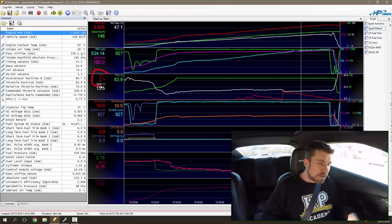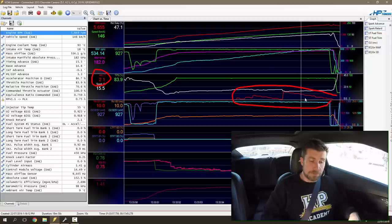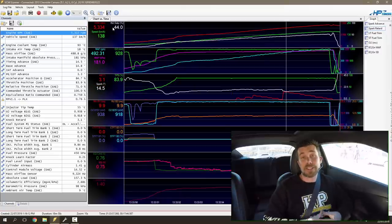The other aspect we're looking at here is our ignition timing, and in particular what we're looking for is any areas where the factory ECU's knock control strategy has sensed that the engine is suffering from detonation or knock and retarded the timing. We can see that we do have a little bit of activity from our knock control system - particularly here at 5300 RPM, the ECU has retarded the timing by three degrees in order to stop the engine from suffering from knock. These are the two aspects we're using for feedback when tuning on the road or racetrack.